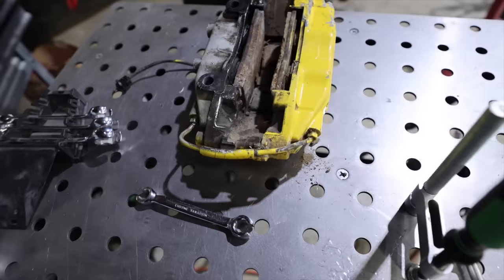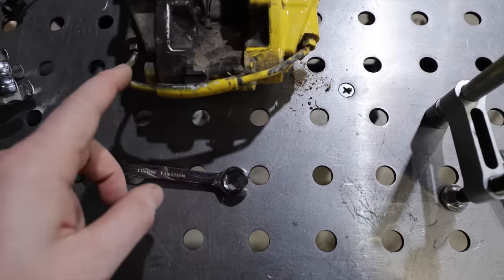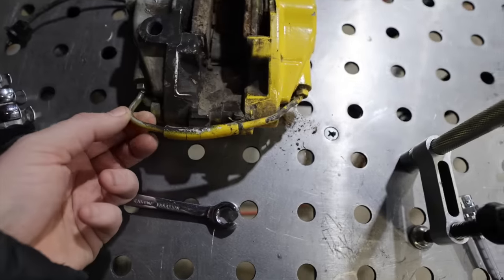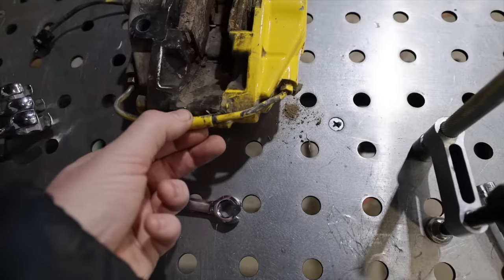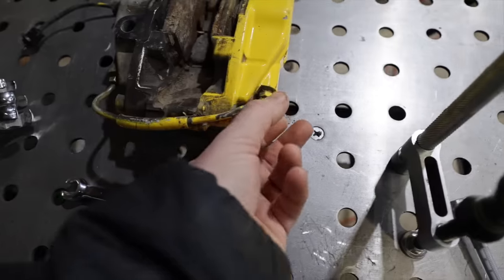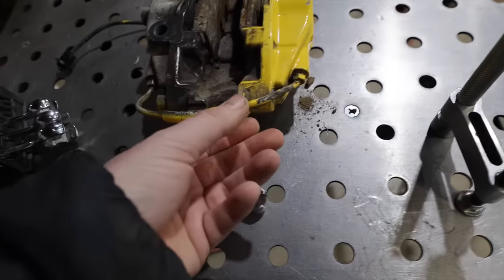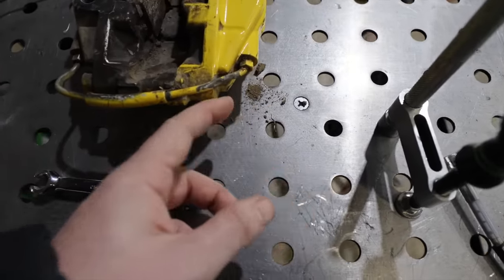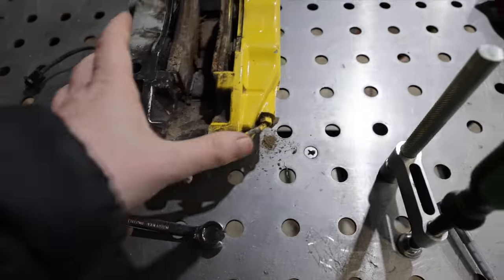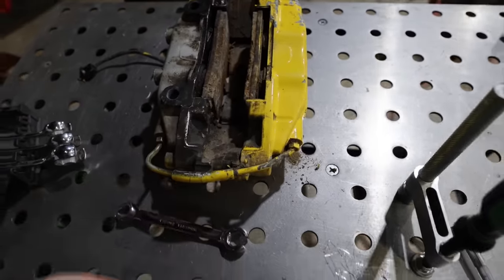In the crash, the caliper took a little bit of a hit. There's a steel brake line that runs to push fluid from one side of the piston to the other, and it's been damaged beyond repair, but it's not difficult to replace. You just basically unscrew it here and here, cut the steel brake line out, grab some new steel brake line material, run your own little loop, and put it back together. The caliper will be good as new other than the obvious cosmetic damage — that's a problem for future Kyle.